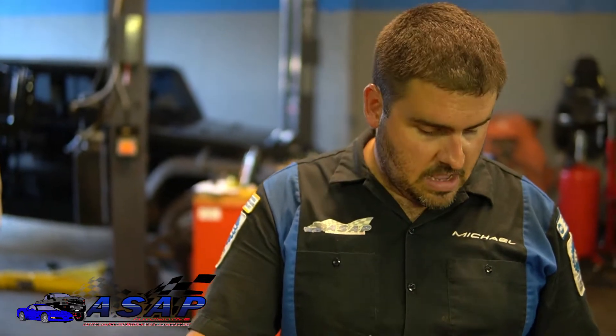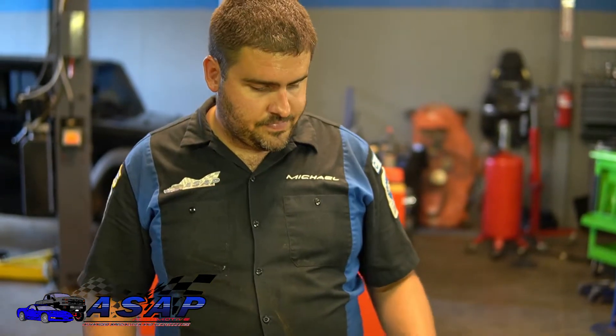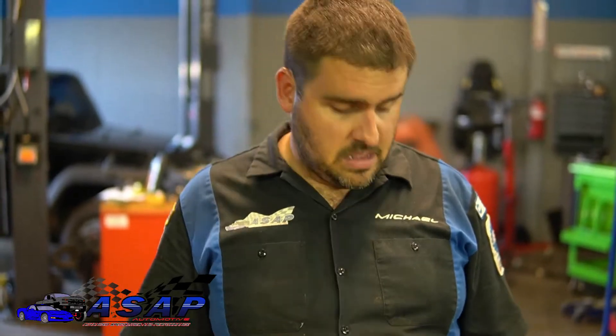So like I said, we're putting a stop to poor braking performance today. The brakes on this thing are toast. My only downfall with these Z06s — I love the cars, it's been my dream car — but the only shortcoming is you pretty much got factory C5 brakes with it. The calipers were painted red, that's about it. So we're once again taking some stuff from a C6 Z06 and putting it on here — that's where these brakes are coming from, all brand new.